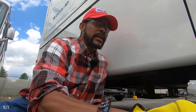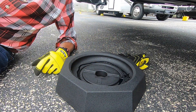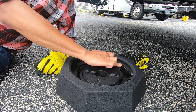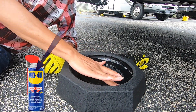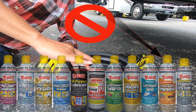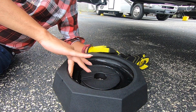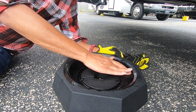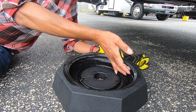To get started, I have my dishwashing liquid of course. I have some wood — make sure it's going to be level, and if it's not going to snap in I can use that piece of wood to help it a little bit. You're going to do one landing pad at a time. I'm going to add a little dishwashing detergent — I have my Dawn here — and I'm going to use my finger just to swirl it around in here, because you want some lubrication. Don't use any WD-40 or any lubricant like that, because that's not going to work with this rubber. Once you get that nice and lubricated with the dishwashing detergent, that helps it under the ring here.